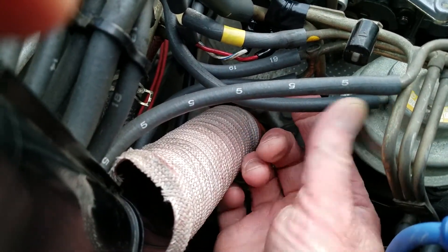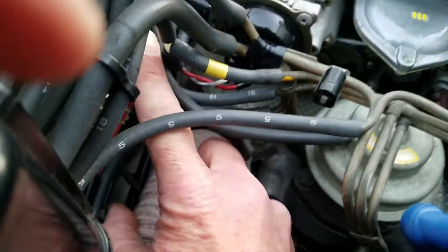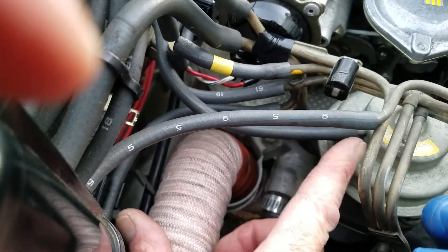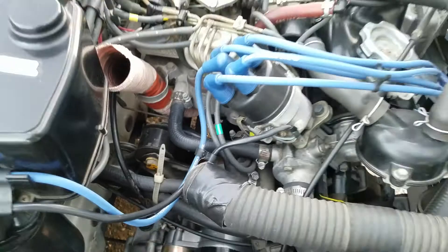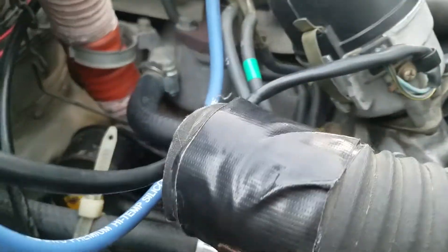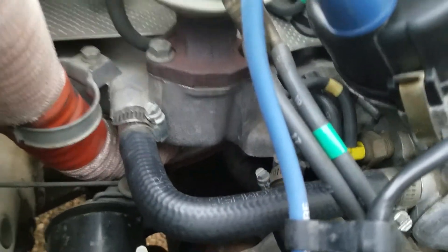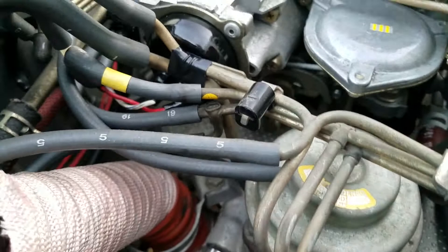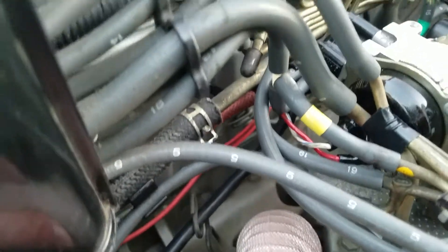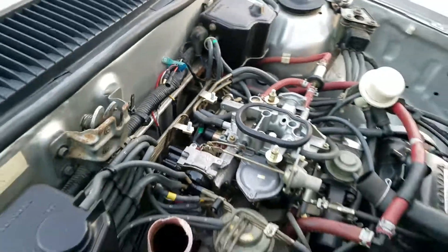If you had them all off you might get those two switched — so the charcoal canister 7 goes to the lower of this metal pipe, and the 16 here goes to the diaphragm. Everything else is pretty clear cut. Let me give you a slow look on this side — good luck.